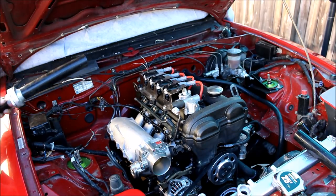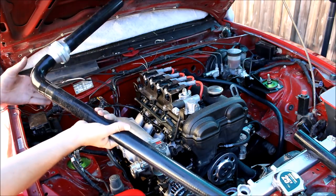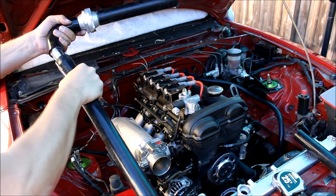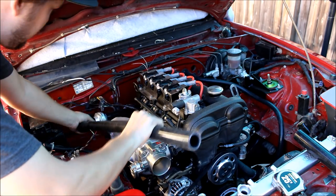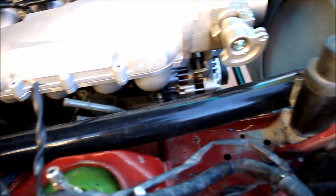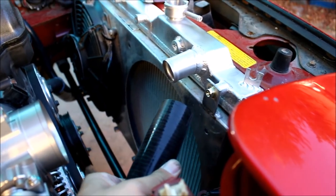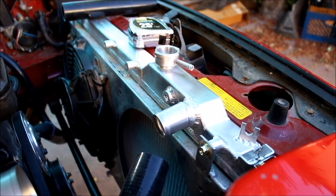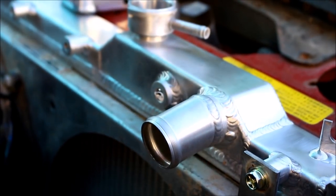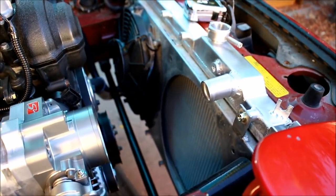The coolant feed into the back of the motor with the reroute is also very simple: a straight piece of silicone hose, the inline thermostat housing that comes with the M-Tune reroute, a 90-degree elbow, and a little coupler in there — that's how you connect the silicone hoses. It gets hooked up at the reroute, comes out right here to the housing, and then alongside the manifold. When you're running a reroute, this is always kind of a pain — the radiator neck is designed to go to the front of the head, so I'll probably end up running a 45-degree elbow off the radiator and hooking it up into this system. Another option is to have your neck modified or angled to be more appropriate routing for a reroute, but the way I'm doing it will work fine.